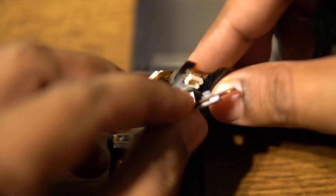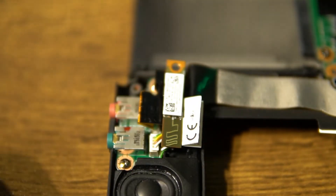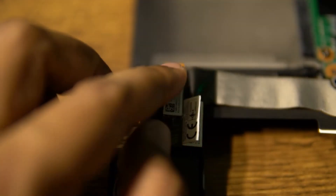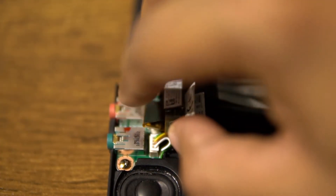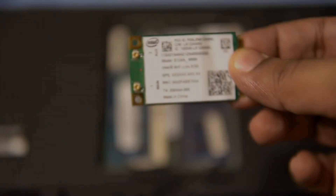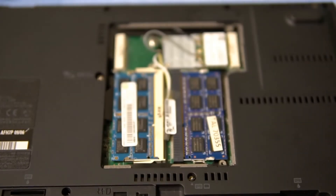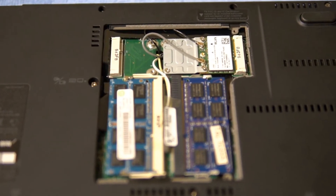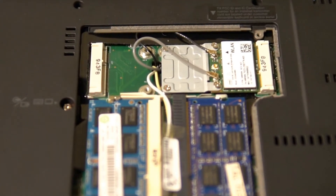As the hardware whitelist was already taken care of, I replaced the Bluetooth module from the stock one supporting Bluetooth 2.1 to one that supports Bluetooth 4.0 while reassembling the machine. Strangely, this module was on a ribbon cable that plugged into the board. I also replaced the Wi-Fi module with my standard Intel Centrino Ultimate-N 6300 using an extension bracket, which was my final step in the entire restoration.